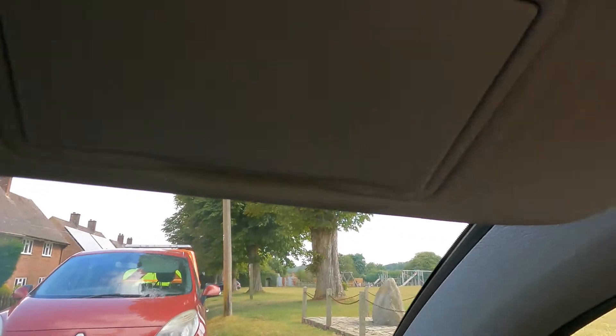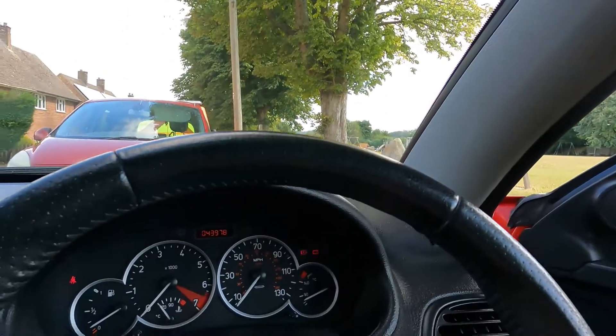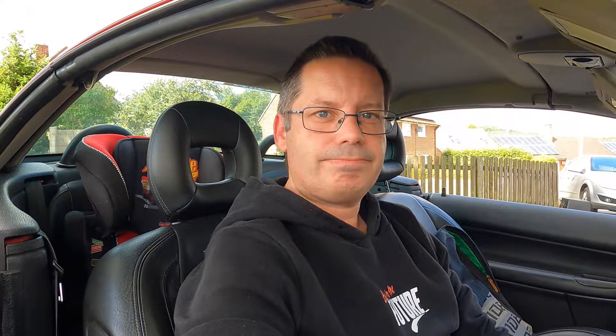You then close off the latches on either side and you're done. Simple as that. So before you go down the complex route of trying to figure out whether you've got any issues with sensors, or the plumbing for the roof, or anything like that from a pneumatic point of view, just check that load cover is in place. If it isn't, close it. If it is, release it, put it back again, make sure it's seated, make sure the contacts are clear, and re-try. Thank you for watching — you never know, that may have helped someone. Thanks a lot, bye.